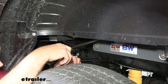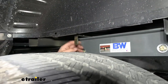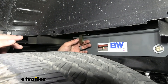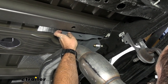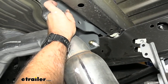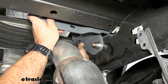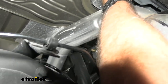Get the handle in place now as it'll be easier for later steps — it goes a little past the inner fender well, so make sure it stays in place. Grab the plates where you hammered in the threaded bushings; they'll go up accordingly. Use the thread-locker bolts here and hand-thread them in for now. The holes should align pretty well with the side plates just installed — one there and one on the outside of the frame rail.